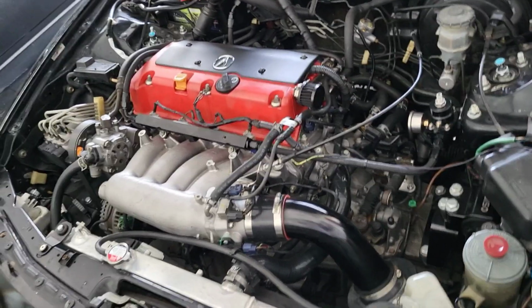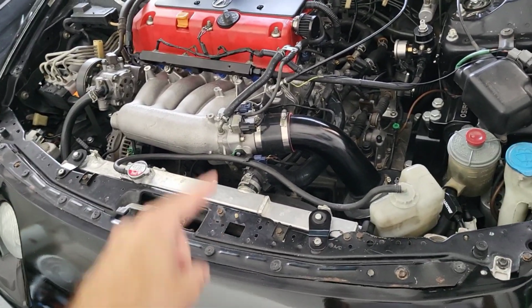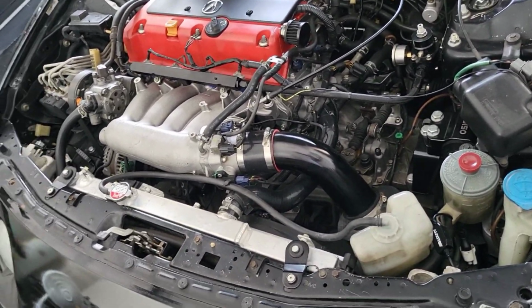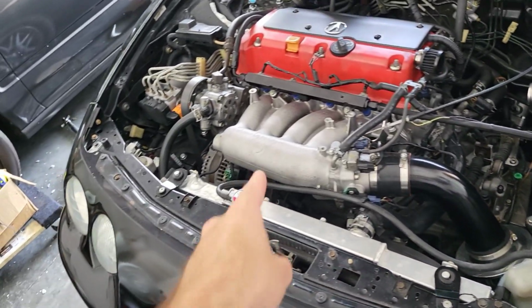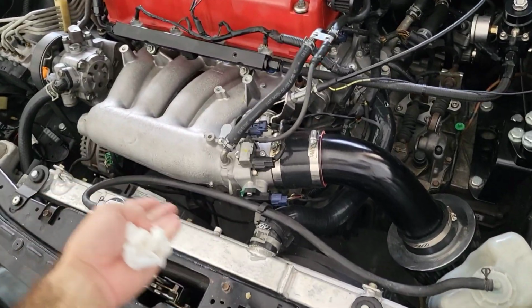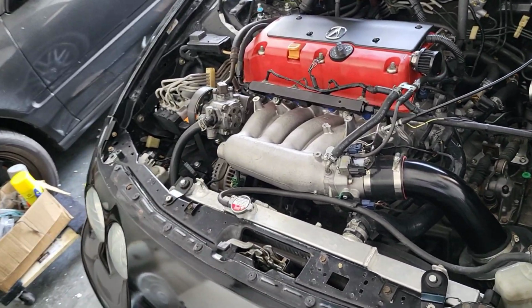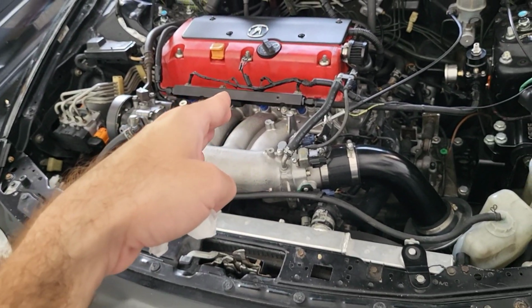But yeah, just wrapping everything up real quick. The radiator plays a huge part. The fan plays a good part. Don't cheap out on it. The thermostat, whether you're running one or not, plays a huge part. The way you have your lines routed, your upper and lower rad hoses, plays a huge part as well. Air bubbles stuck inside.